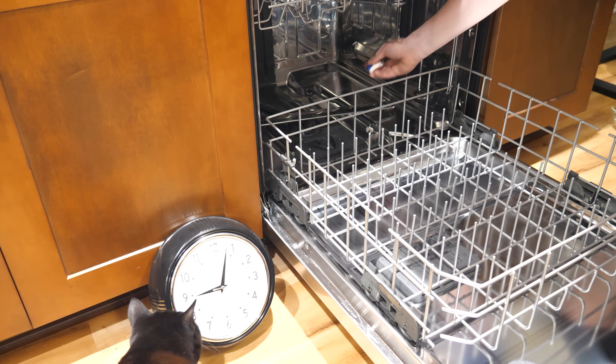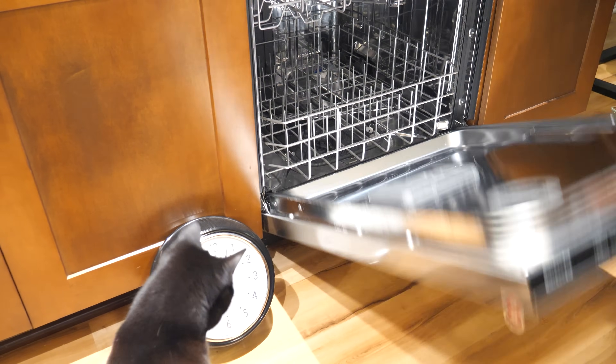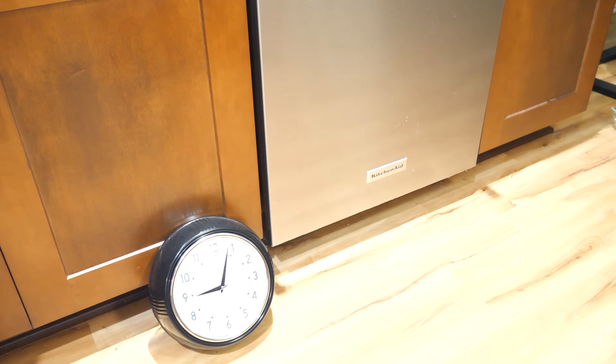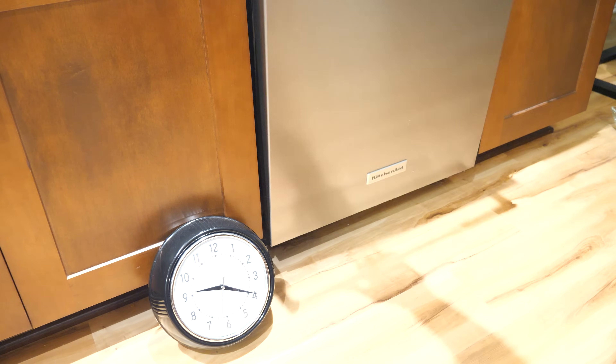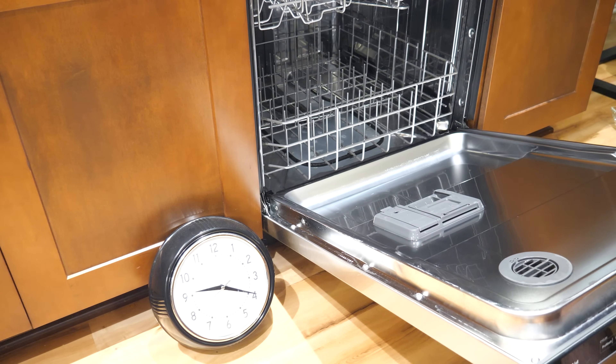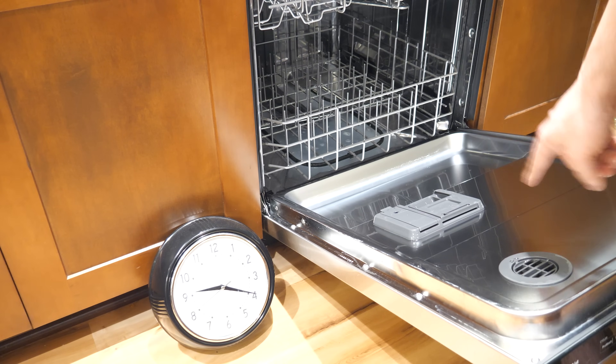I thought, well, I opened the door and interrupted the cycle — it's probably got a weird cycle timer, I'll do it again. So I did the test again and this time I decided I was going to put the pack in the back right corner, because the first time I put it right by the intake for the pump. I'll try to give it some more time to dissolve. So I put it in the back right corner and this time I was going to wait until it had drained to see if there was anything left there. Again, well more than ten minutes had elapsed and the dishwasher didn't drain. I opened it and noticed the water seemed hot, much hotter than it normally is. And then I also noticed: I didn't close the detergent dispenser on either of these test runs and I think it knows it's open.